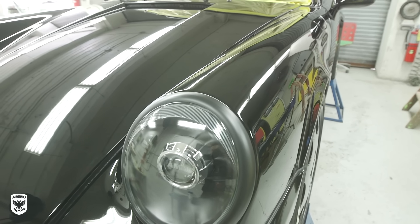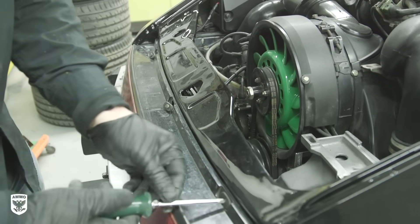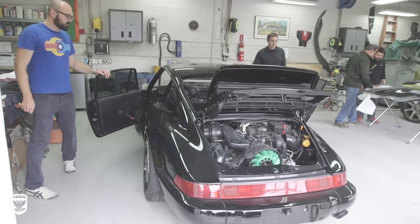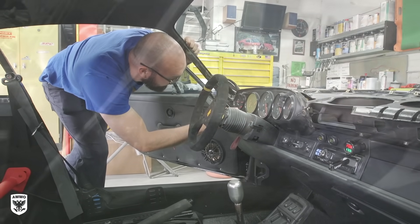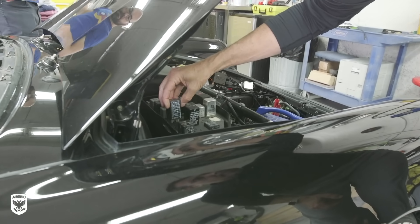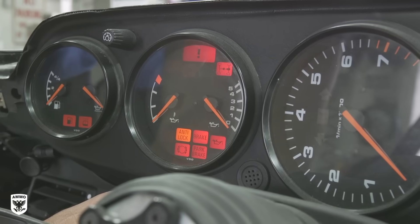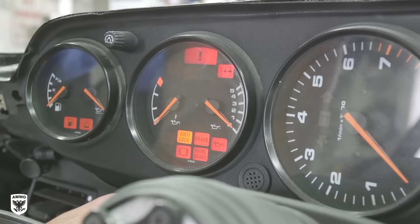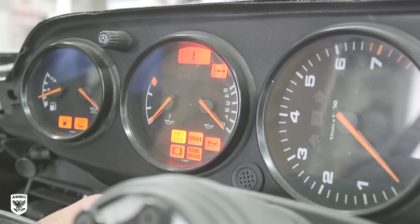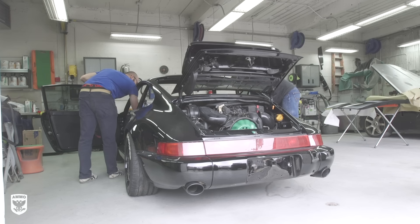The engine hadn't been started for a few months, so I called my friends Mike and Dave from the Porsche 964 C4 Club to help ensure we didn't score the cylinders or cause unnecessary wear on first crank. Mike unplugged the DME relay under the hood, which powers the engine management software and shuts off the fuel pump to prevent the engine from starting. Dave added fresh 93-octane to the tank and cranked the motor a few times to build up oil pressure before officially starting the car. The initial startup was a bit smoky, which is typical for my 3.8-liter, and the engine is running well.